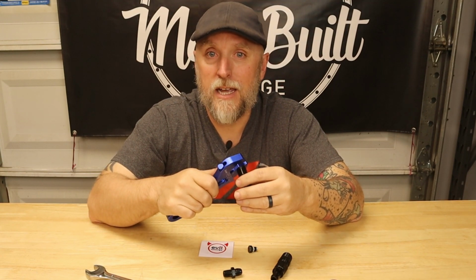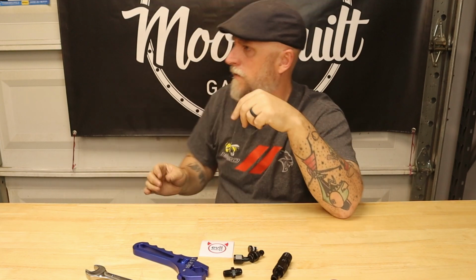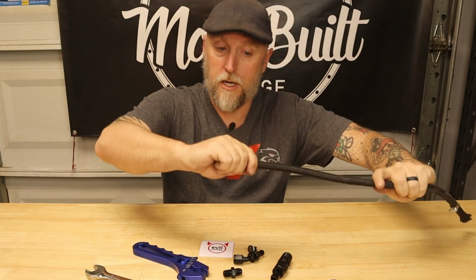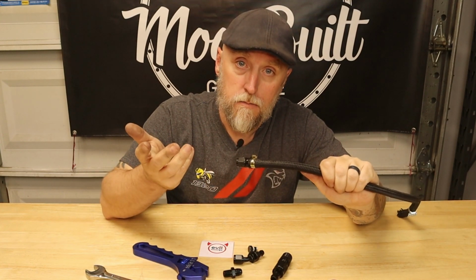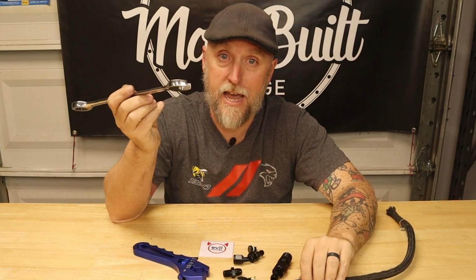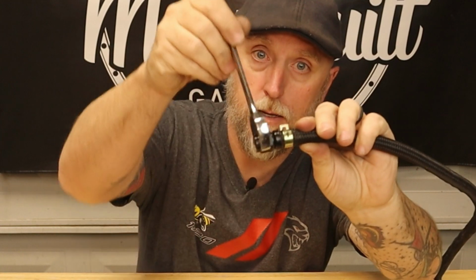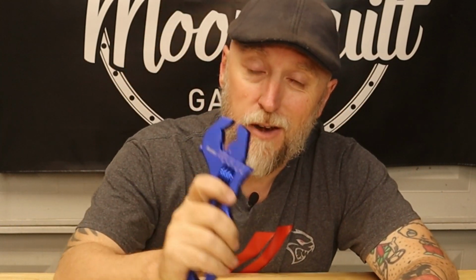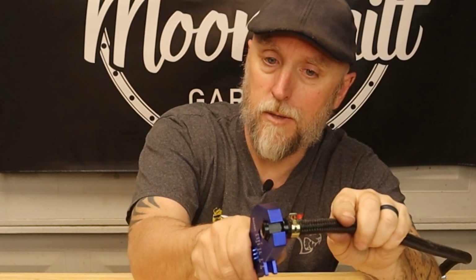And that's because it's inconvenient. If you're working in a kind of tight spot, especially if you've already got the hose attached, let me see if I have one. I don't know if I have one available. So yeah, there we go. I've got one with a piece of hose on it. So if this was, let's say, a fuel line going to a fuel filter, and I had to clean my filter, with a normal wrench, and a lot of AN wrenches have jaws just like that, you can just slip the wrench on there and break it free. These, you can't really do that. So you kind of open them enough to get over your hose, and then come down to your fitting, and then close them around your fitting.